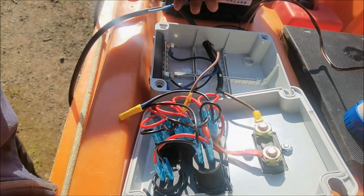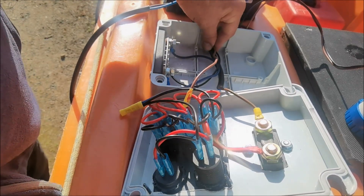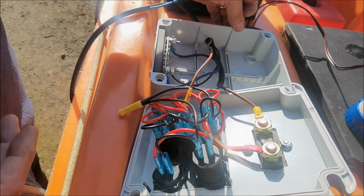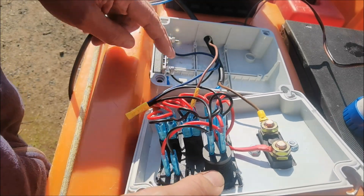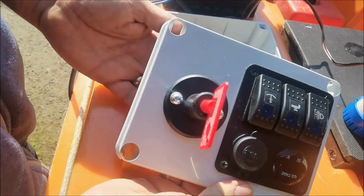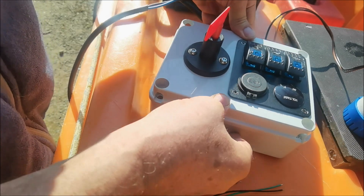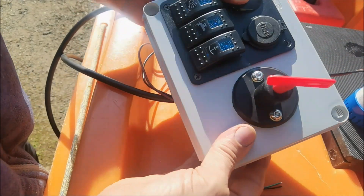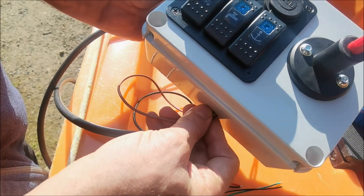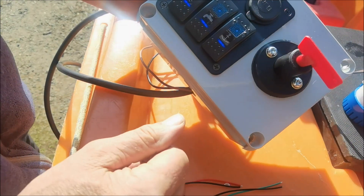Finally, a little tip: anything coming in, leave a little bit of slack so you've got room to work with. Always put a tie wrap around the cables here so they won't pull out — put a substantial one. If you need to drill a hole they do the same, so they can't pull through. Also, notice this wouldn't fit in properly, so it goes the opposite way around — like that. So you tuck it all in. Every wire comes from the bottom, and I will seal that either with a grommet or some silicone. And there we go — she's on.